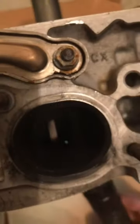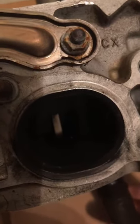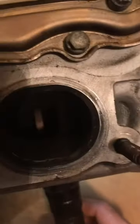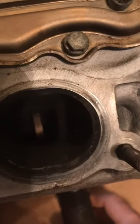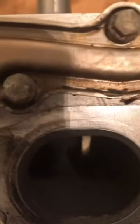I thought this would be easier to show you guys, but clearly not. The point is I'm shining the light on the opposite side of the valves, and you can clearly see the light coming through the seal — where it's supposed to be a seal, there is no seal. Yeah, this one's pretty bad too.